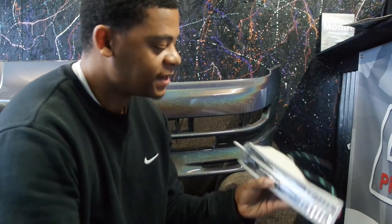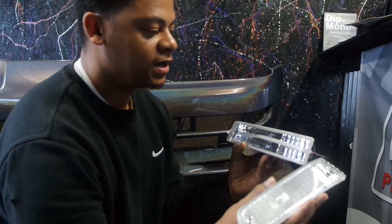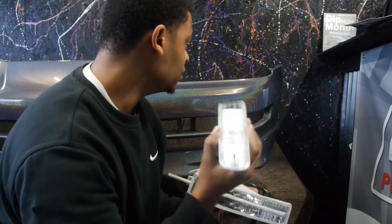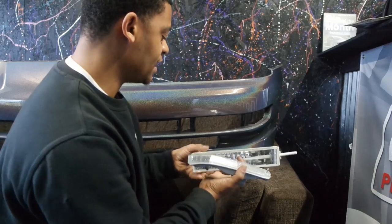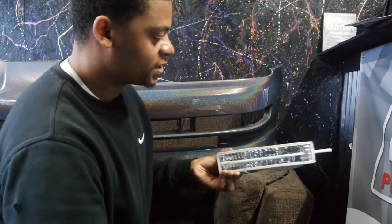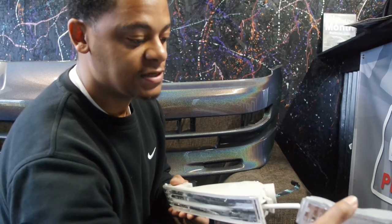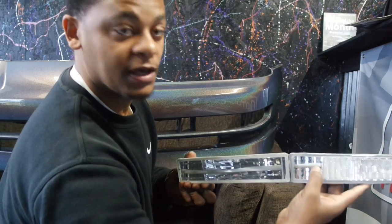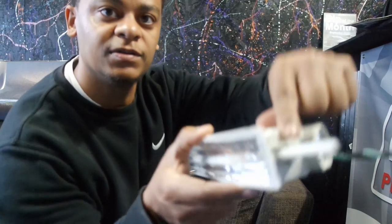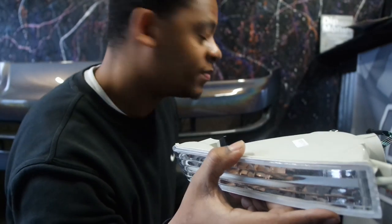I got the LED strip in the housing, ready to go. The LED sweeps from a specific direction, so you're going to have to feed it in from the inside. If you're looking at the bumper and it's on the right, you're going to have to feed the LED in from the inside and go that way, because that's the way that the sequential is going to sweep. You'll notice that the LED is sticking out of this end — I'm going to show you why. Once I get this first one in place, this other one actually fits right in there with that other hole where I drilled, and it goes inside this housing. This little edge right here does go into a slot on the bumper, and that's the first step.